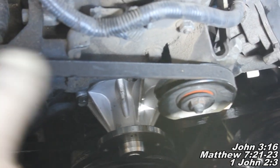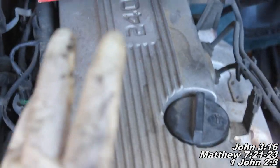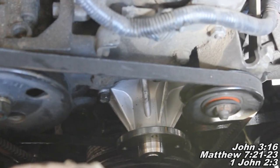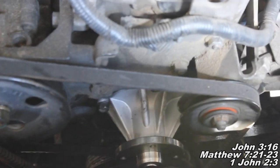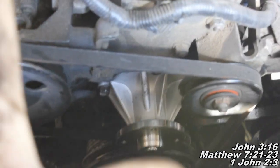These bolts don't go down to about 60 foot-pounds, because I think for the 3.0 version it's like 58 foot-pounds, and this is the 2.4. So you definitely don't want to go that tight with them. Just snug that and it should be fine. Next, we'll talk a little more about putting everything back together.